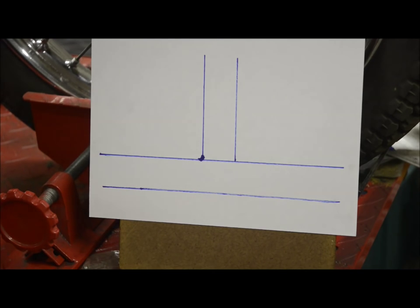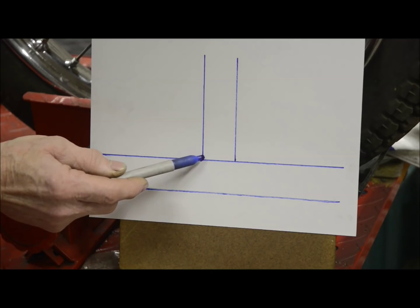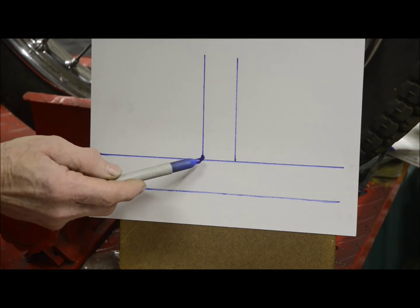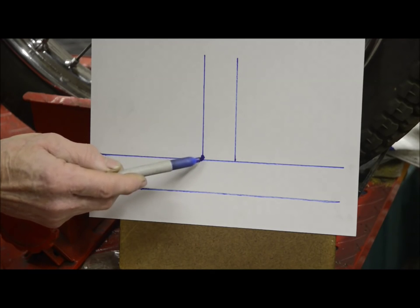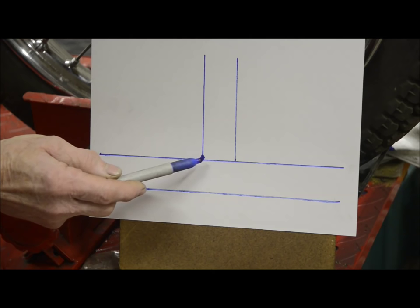But what it will also do is concentrate all of the heat here, particularly with the electric forms of welding. You'll get very little heat transfer, so you tend to get a slightly brittle portion of metal around the weld. Gas welding is a little gentler because it takes you a while to get this part molten to make the fusion, so the heat tends to spread out a little bit. But even so, you're still melting and changing the physical characteristics of the metal at this point.